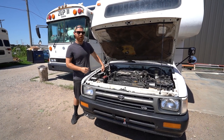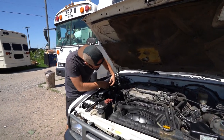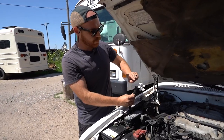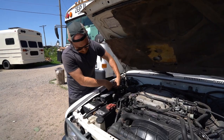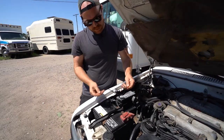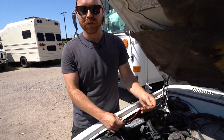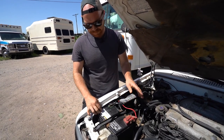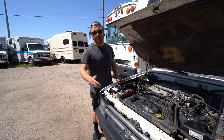The Part Sam wiring harness comes pre-fabricated with the relay switch, and all you have to do is mount this and ground it to the chassis of your vehicle. Once you've done that, you would connect the positive and negative terminals. The great thing is they've also put an inline fuse for the positive terminal, and then you would run your wiring to the desired location for the LED bars.